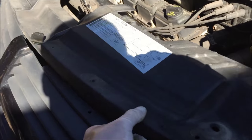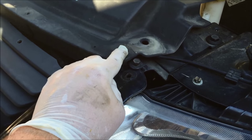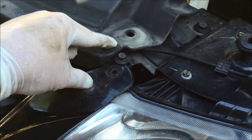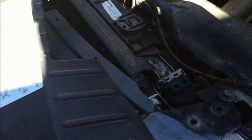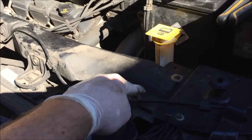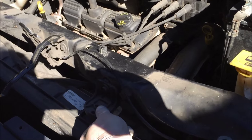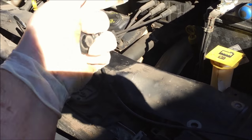You need to remove this — it's the front bumper cover. There are some Phillips head screws in here, there's a 10 millimeter bolt through in here — I've taken this out — and then there's a plastic pin that goes in here, connects those two, so you just use a screwdriver to pop that pin out. Then you just have to move the cover around a little bit and it will pop out; you can just tuck that away, and you can start to see the system in here. This is the AC condenser, behind it is the radiator, there's the two cooling fans in the back. This is the radiator support bracket — there are four 13 millimeter bolts, two on each side — just undo those. This does lift away clean, but there's a hose attached to it, so you don't need to dismantle the hose, just tuck this away up on the top of the engine.